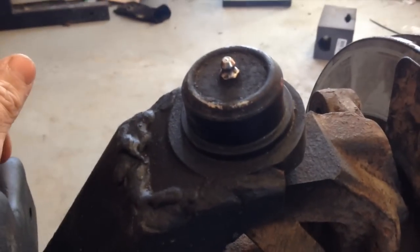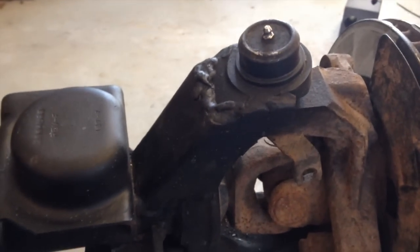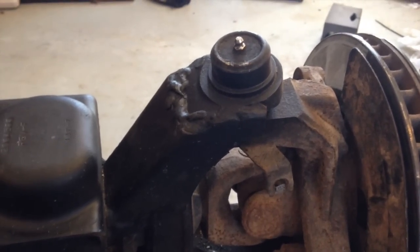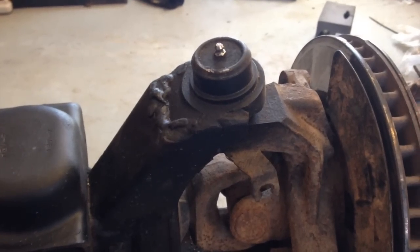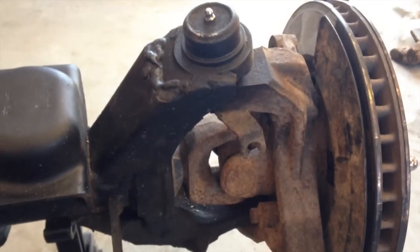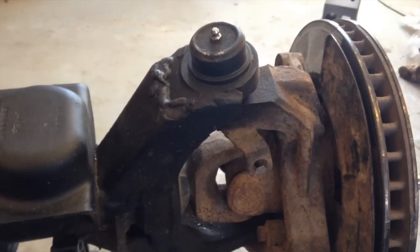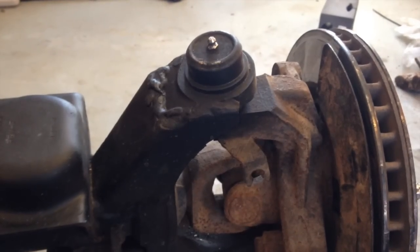These ones here are Synergy ball joints, or Poly Performance — upper and lower, and they have grease zerks. If you get RCV shafts, there's a special zerks fitting for the bottom one so you don't have to break it off. Teraflex, Poly Performance, and Dynatrack make their bomb-proof ones for a price. Do not get adjustable ball joints — they're prone to failure and you just don't need them.